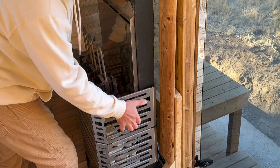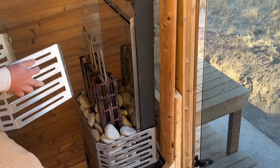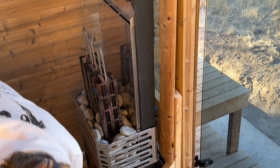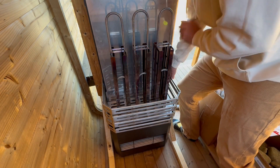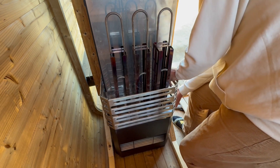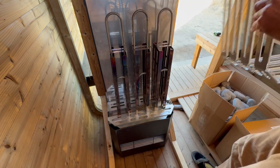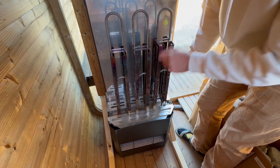Remove this, lift up, push back, and then bend it out. Once all your stones are removed you can pull the bottom cage off in the same way. This one's probably going to be tight just because it's had some weight on it — same thing, pull up and then push backwards. You're going to remove these little retainers, they're just slipped on over top of the elements.